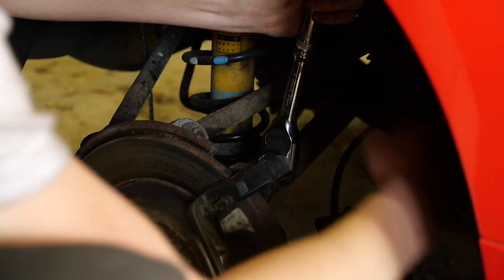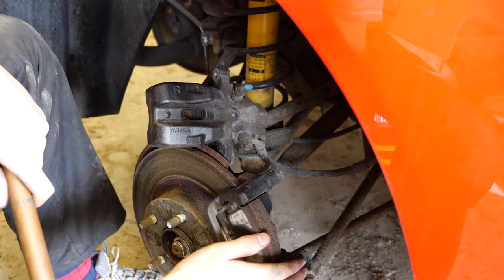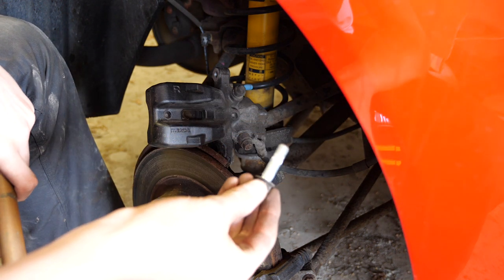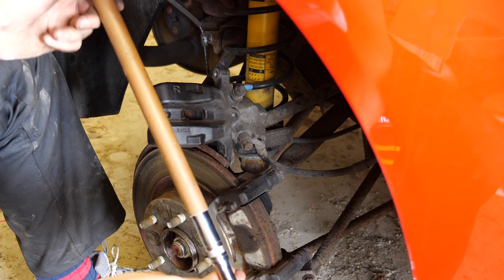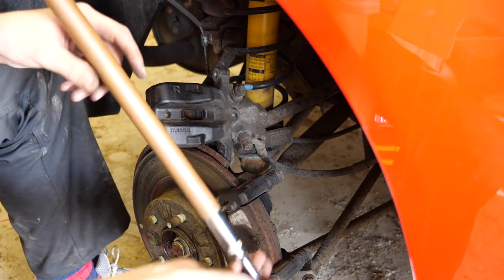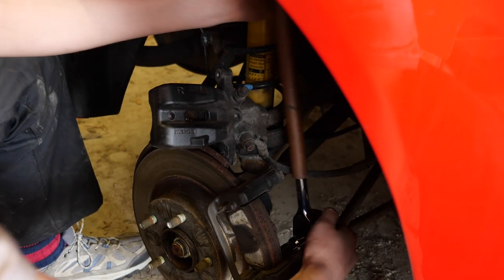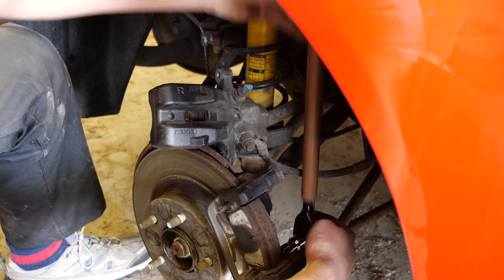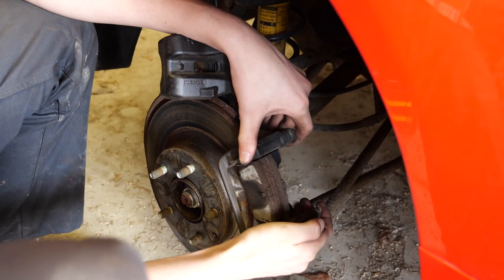I really need some sort of metal bar on top of my ratchet to give me more leverage — these caliper carrier bolts are pretty stiff. I didn't have the camera on whilst I took that first one out, but they're very very tight. I've got a half-inch ratchet with a bar extension to give that extra leverage. Second one — yep, that's got it. I also had to increase the internal diameter of the bar. Second bolt out, jobs a good 'un.